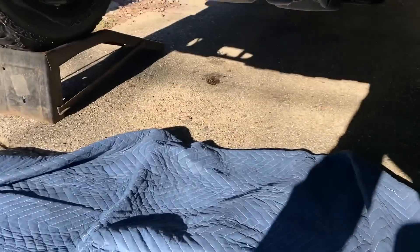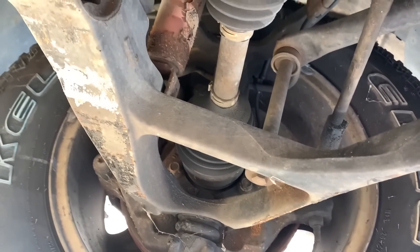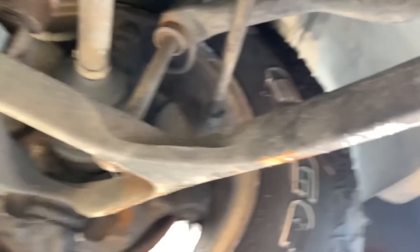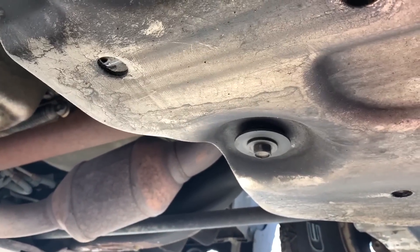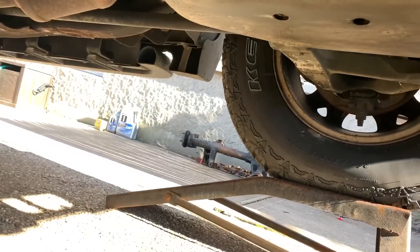Alright, we're all up on ramps — let's crawl under here and see what we're looking at. The axles look good; a lot of times those boots rip open and fling grease everywhere. Sway bar links are intact. Shocks are a little eh — I don't know if they have the originals or not, I would hope not, but when I drove around the block it rode fine so they're probably alright. Transmission looks good — wow, the transmission actually has a drain plug. The oil pan looks like it's leaking, but that's pretty common on these; nothing I'm probably going to address right now, it's just a little seepage. The diff looks fine, don't see that leaking.